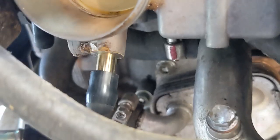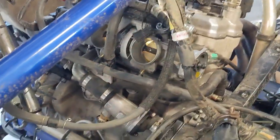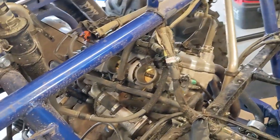As part of removing the air injection system, you have to cap those ports. See those three shiny gold pieces? That is where the fumes would be sucked back into the engine — you have to cap all of those. I used this little cap kit right here — you'll need the part number. I also decided to cap this fourth smaller port back here. It had a line hanging off of it going to nothing, so obviously it wasn't doing a whole lot. I don't know what that's for — maybe lubricating or spraying some oil into the throttle body. I capped it for now. We also don't like any openness because we go in deep water, so the weep hole for the water pump is going to get capped to keep mud and debris out of that little orifice.